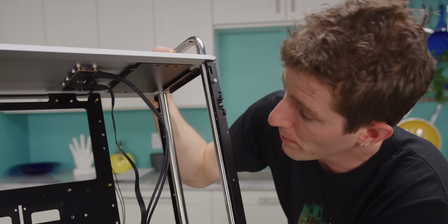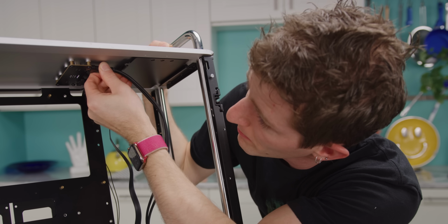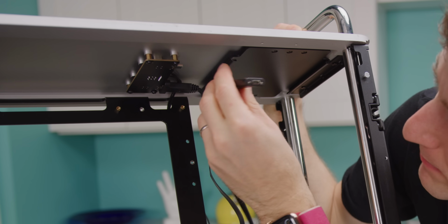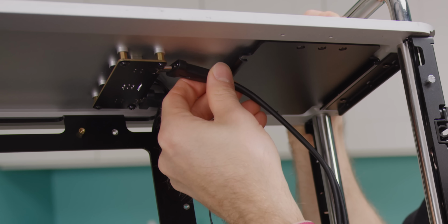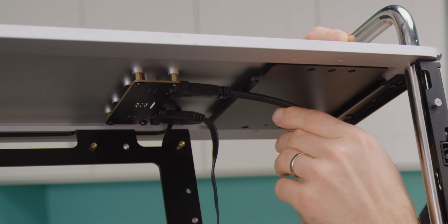And while we've got it torn apart, I guess now's a good time to show you this. This is kind of cool. So there's a little daughter board up at the top that has 2 USB Type-C plugs. A little flimsy, be careful when you're cable managing it, but these are the internal USB connectors. So you could just use any female to internal connector here. So depending on how your motherboard connects its front USB, you're not limited there.